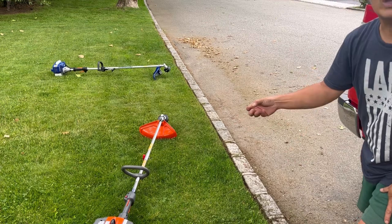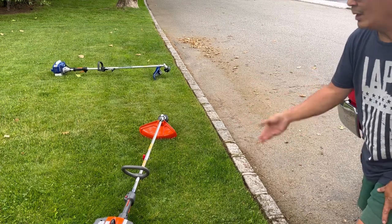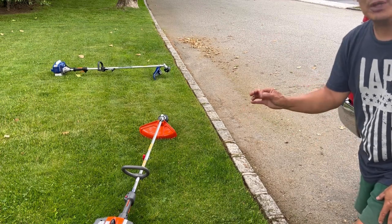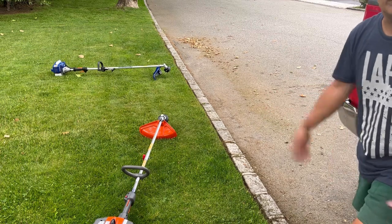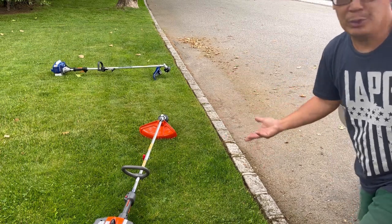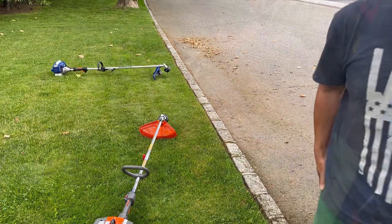As you saw again, quick attempts to have the responsiveness on the throttle caused it to stall. I think it needs an adjustment on the high-low air-fuel mixture. But listen, people buying it right out of the box shouldn't have to do that, right? I'm gonna adjust it anyway, and let's see if it runs better.